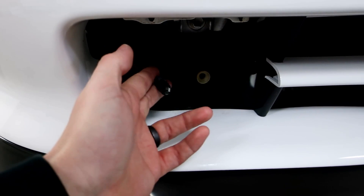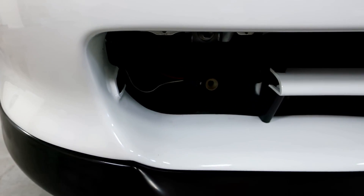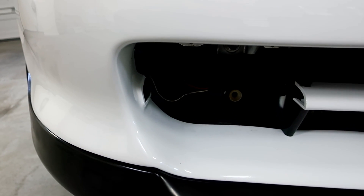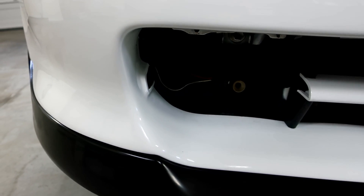So I'm getting underneath the car here and backtracing the wiring, seeing where it could possibly be failing. Is it actually failing at the connector? Is there other wiring it's going to, that's been spliced in and not working? That's what I'm trying to look into right now.